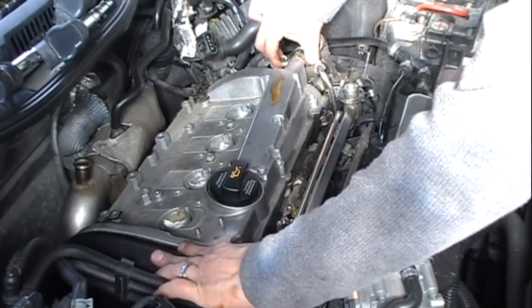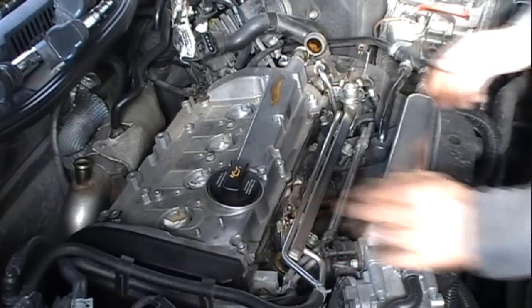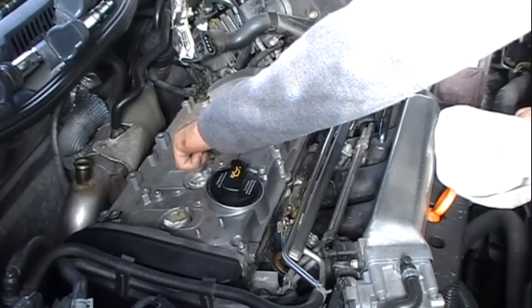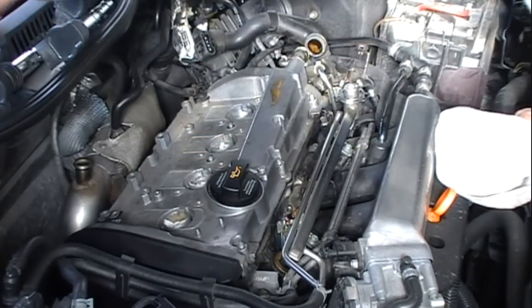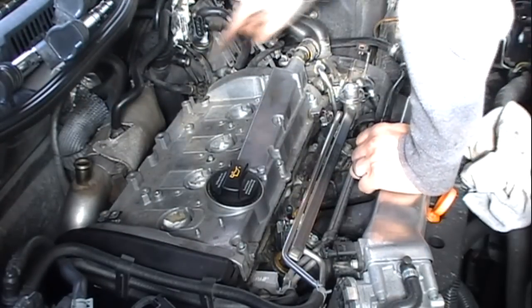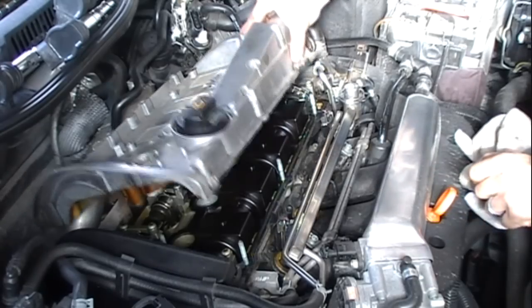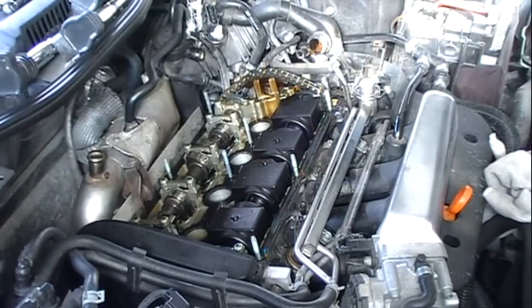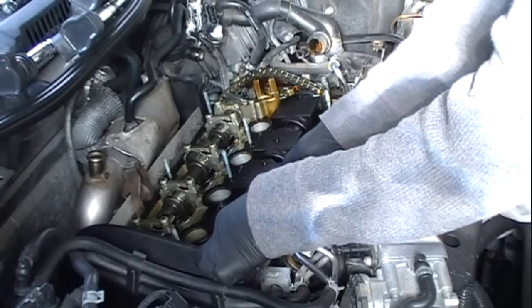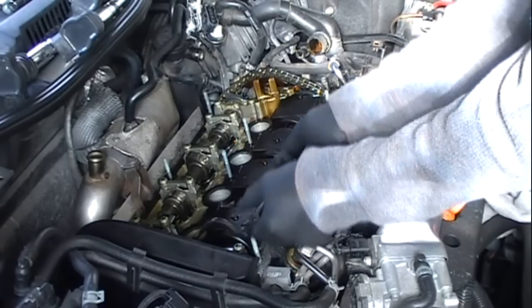The thing is, it's hot as hell. Lift up right here, start to come off, lift up here. Free it up, it unseals itself. Got to move these. Make sure to remove the middle nut. I just use a screwdriver to bend that hard line out a little bit. Lift up the old gasket, get it up off the studs.